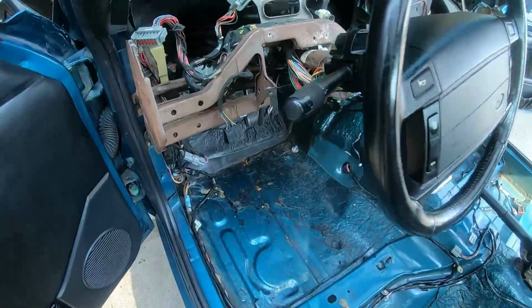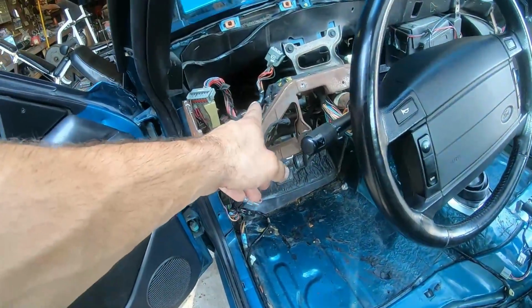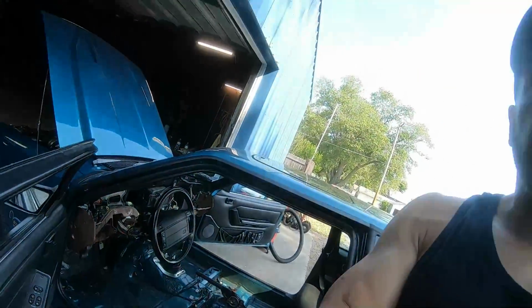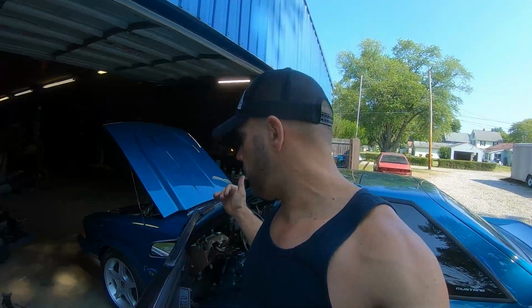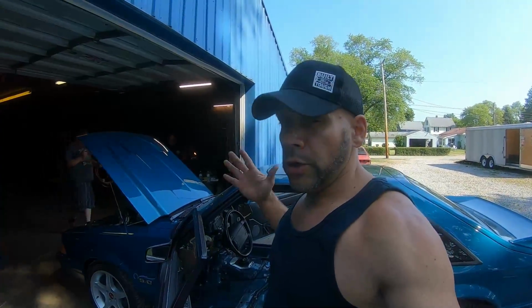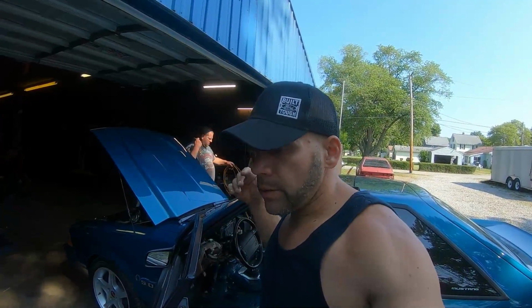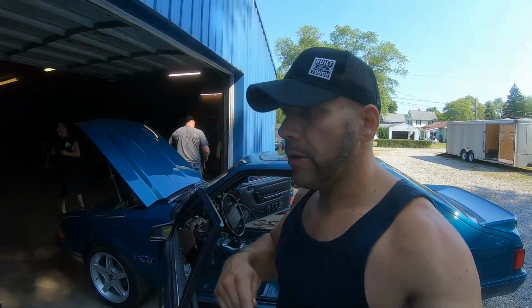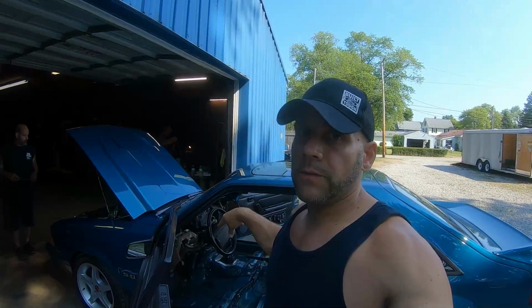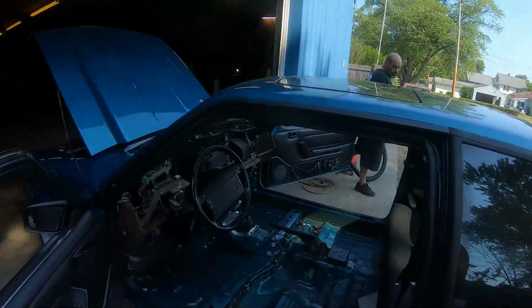The reason why I'm adding this to the vlog is because we had a neutral safety switch problem. You guys saw it yesterday. Basically, all we did was take the neutral safety switch apart and clean all the contacts on the inside, and we put it back in and it worked just fine. But we had a confirmed newer one, so we just left the newer one in because we wanted to make sure that was the issue. The only other reason why a T5 swap wouldn't start outside of the neutral safety switch would be the reverse light switch underneath, where that red loop wire is that I was showing you guys, because that directly affects the coil and stuff.